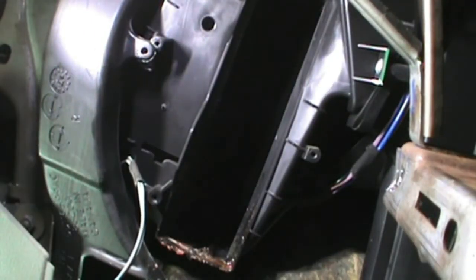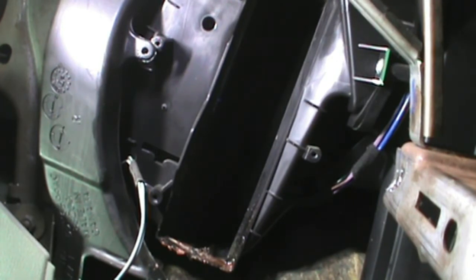And it's out. You saw my foot in there. I had to push on that metal a little bit to get it out of the way. A little twisting, prying. It doesn't look like the actual core itself was leaking. Chances are it was probably the seal in between the plastic tank and the aluminum. That's where they usually leak. And I would imagine that's the case here too.